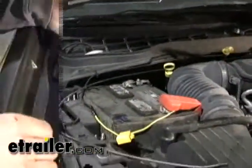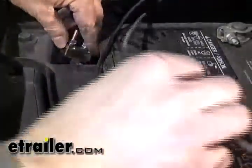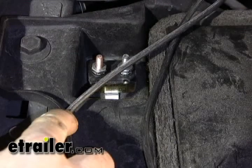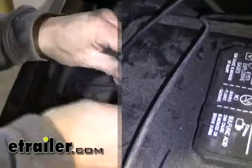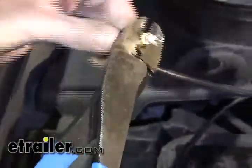Let's go ahead and route our black wire back over to the battery. Let's go ahead and find a place for our circuit breaker. This is going to be the 40-amp circuit breaker and this is going to be for the 12V power supply which we're working on right now. We're actually going to mount it in this pocket right here and we'll run our wire across the terminals and up to the battery. Next, to our wire, we'll go ahead and add our two ring terminals — the small ones will connect to the circuit breaker.